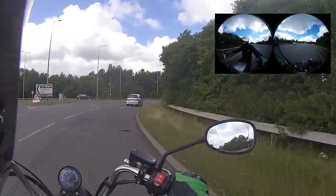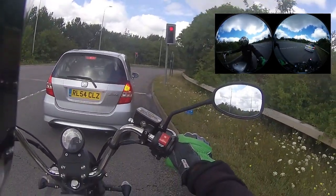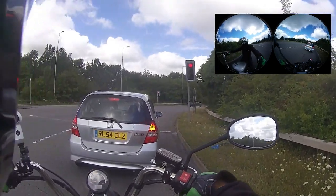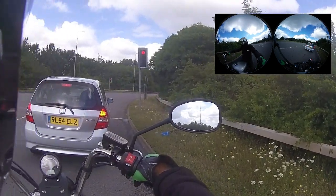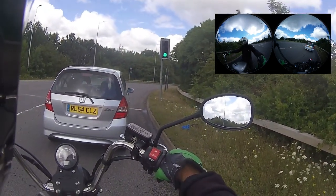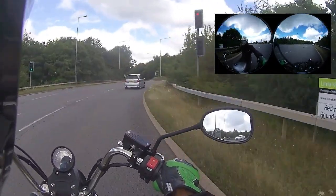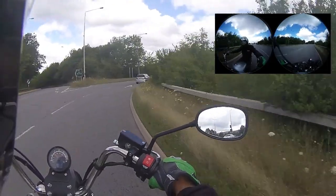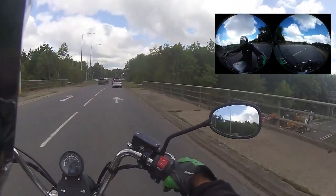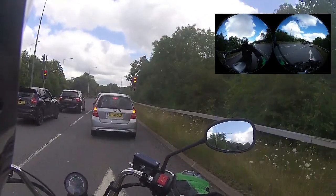Just working through the gearbox, and then I'm going to come in again for a brake test on that front brake. These do have combined braking. We do have a CBS bleeding guide that comes with it because you can find on some bikes the back brake is a little bit spongy and requires bleeding on all three nipples - starting on the front, then the front-rear, then the rear. Sometimes it doesn't take long; some bikes we can be there 20-30 minutes getting the air out of the combined braking system.